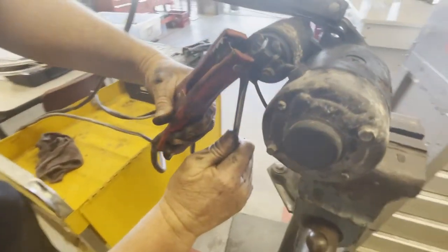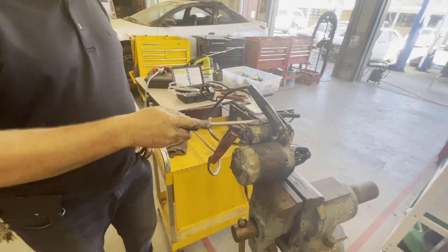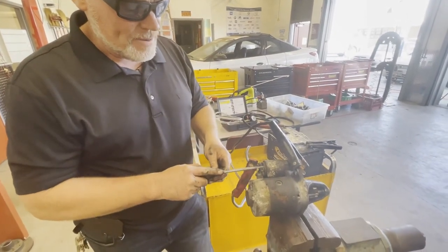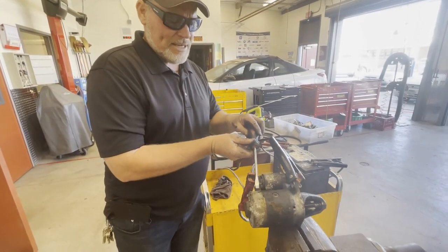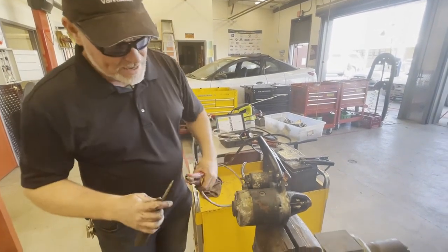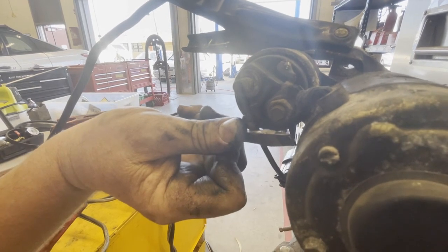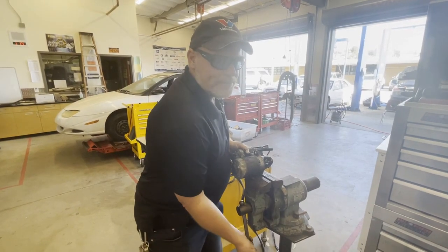You can see I'm just pivoting on that post and just touching it like this. What you can't do is touch somewhere that is part of ground — you get a lot of sparks, that's bad. Touching the housing is also bad because the housing is connected to ground — that's like throwing my screwdriver on my battery. You really got to be careful on how you bridge this. You're going from the ignition wire terminal to the positive post only. If you touch the housing, sparks everywhere — you've got to be really cautious on how you do this.